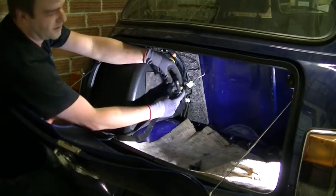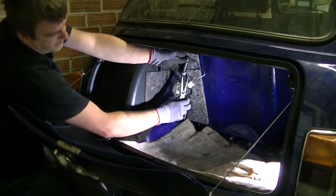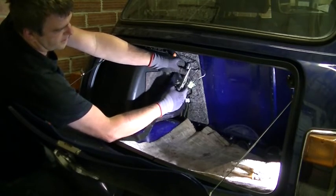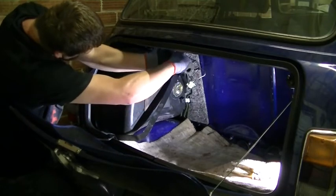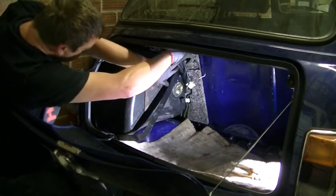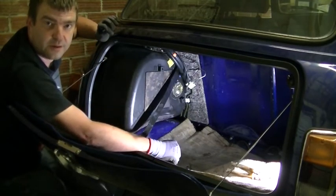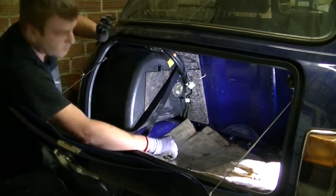Right, the trick with these hoses, or I think that's just found easier getting on that first one, is move the clip to the end of the pipe, squeeze it together and push on at the same time. There we go, straight on. Don't put the hose on first and try and move the clip. It may be how they're supposed to be done, I don't know, but that definitely works better.